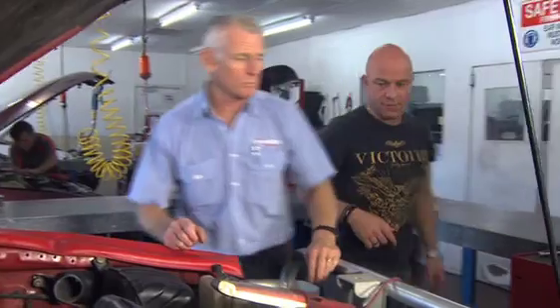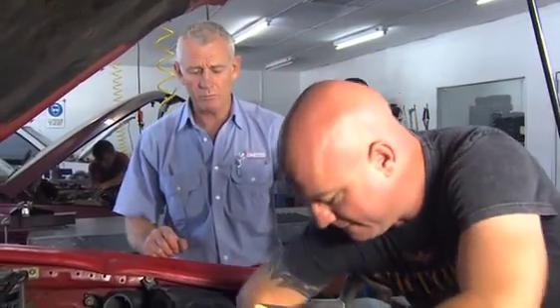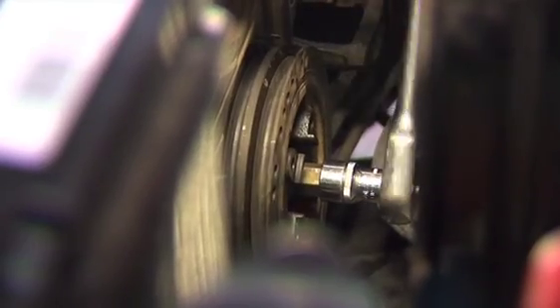Now, you need to come around to the front of the engine. Turn the engine back to top dead centre — line the mark up with the pointer. Clockwise. Okay, that's in line. Check.